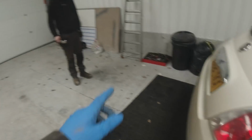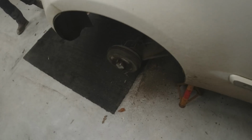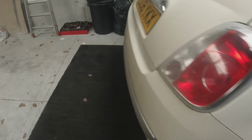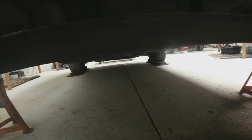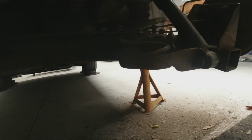So we've got Scotty back in, on a Saturday, and he is wire brushing down that rear beam and the springs on the 500 for that lady, and you can see that actually this is solid as you like. Well, I suppose it might be difficult for you to see. Scotty's taken most of it off now, but it was just the paint coming off the rear springs and the rear beam there, and he's wire brushing it all down. Then we're going to treat it.